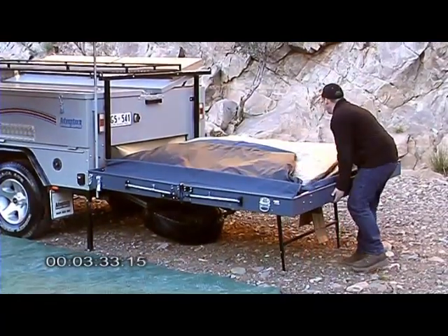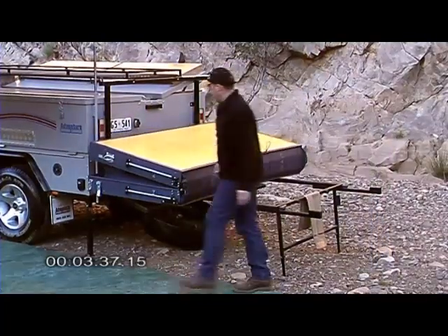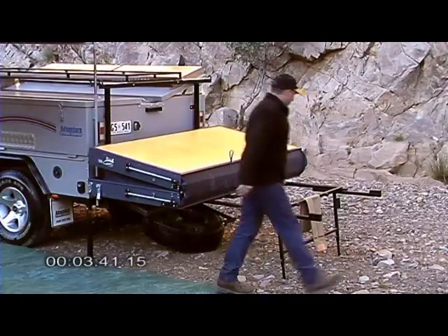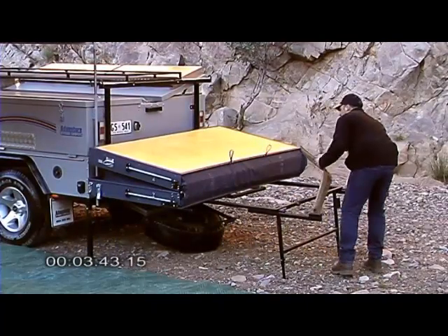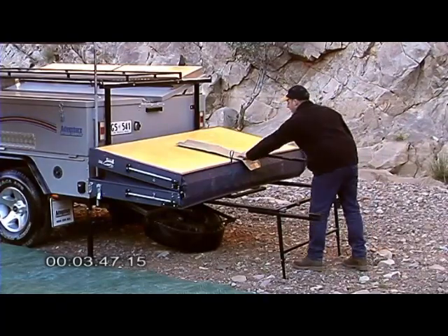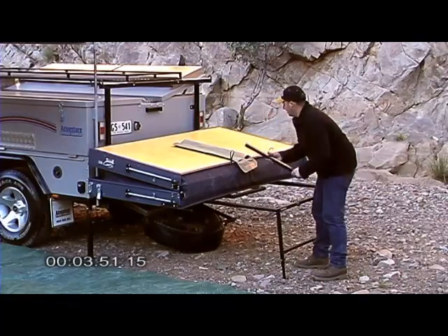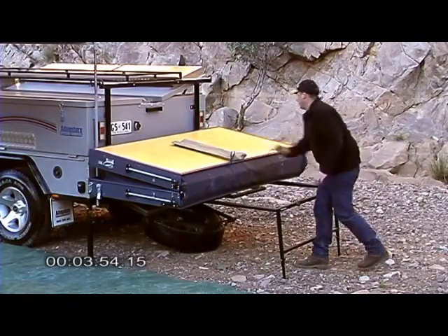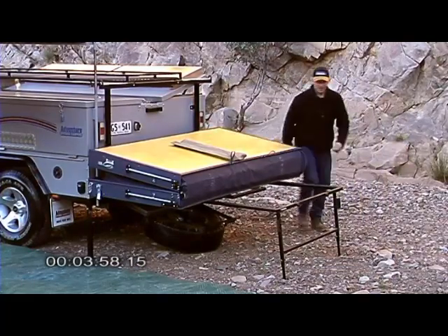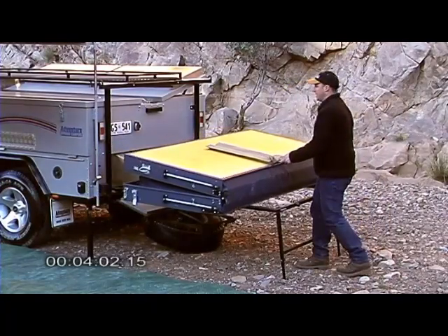Ready to fold it in half — push it straight over. Lift up the rear latches on the back of the trailer. You'll notice that by putting your bag on the end of the bed frame, you'll never lose it. Remove your bed extension arms. Raise the other side latch, then use the pull handles and slide the bed case back.